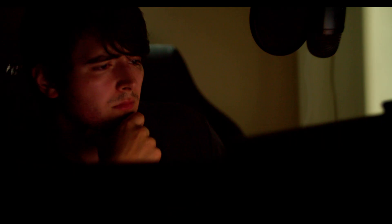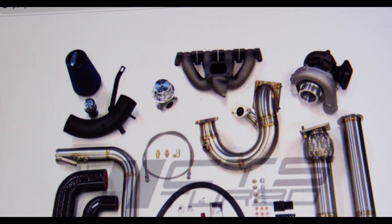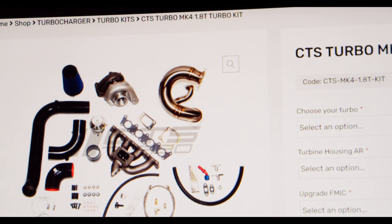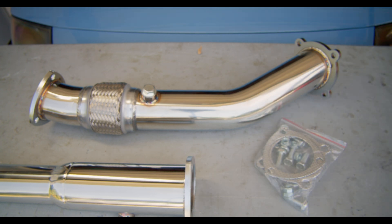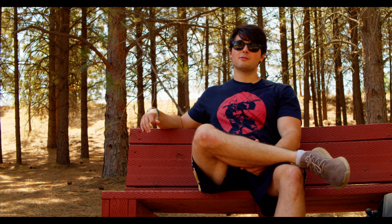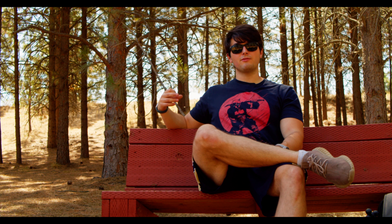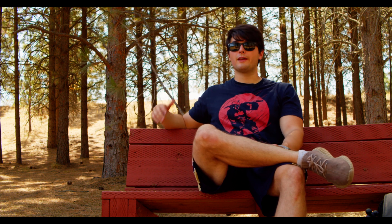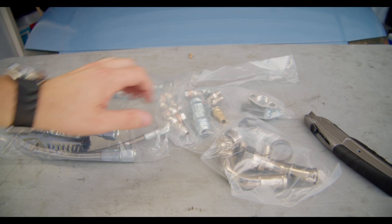Rather than starting from scratch, I thought about it a little harder. When I was researching the old CTS kit for this car, they actually had this pipe — they don't anymore, but there are archived photos of it online. Not only is it pretty simple looking, but it's weirdly similar to a GTI downpipe. They're not the same because GTIs don't have a driveshaft in the way, but the current one on the car avoids this already. And since they share the same tunnel, they're likely in similar spots. Plus our O2 pipe is already built for a GTI downpipe. So this is a cheap stainless steel GTI downpipe — it bolts up to the parts we already have and fits in the Mark IV tunnel. I figure we take the best of both worlds and weld the top half of the GTI downpipe to the bottom half of the 225 downpipe. Hopefully it's as simple as it sounds. I also have gaskets as well as the oil and water lines for the turbo.